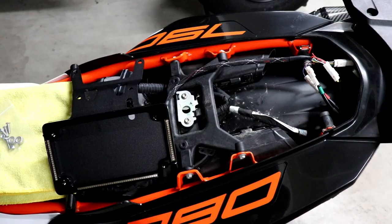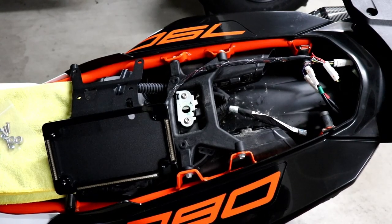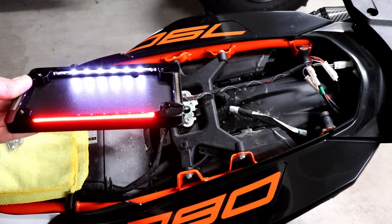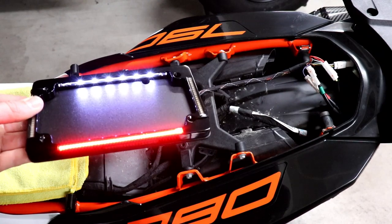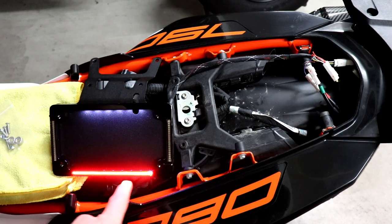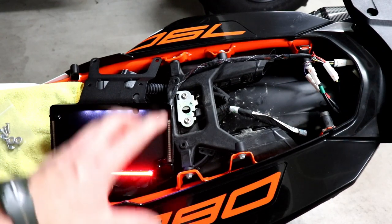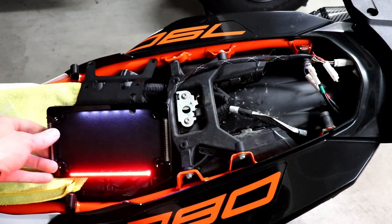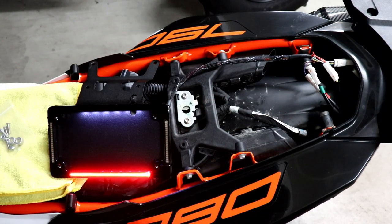Key on — let's test. That is your brake and running light, and the additional one you get with the new plate setup. Left turn signal, right turn signal — and check out that sweet little license plate LED light in there, that is awesome. If you don't disconnect that factory brake light and use those extra two wires, most of it won't work, so make sure you connect everything the right way.